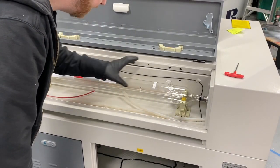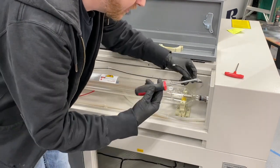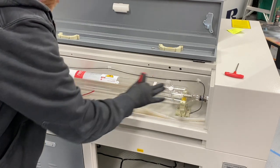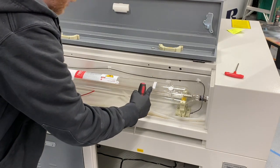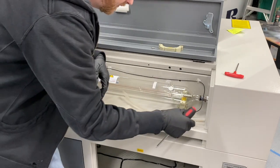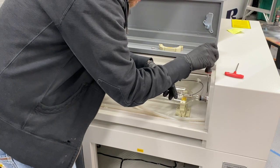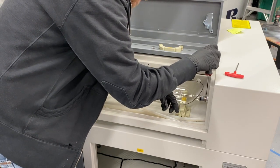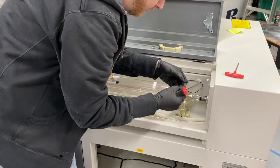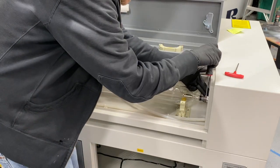Here we are with the tube — I've got it sitting in there but not in its final position yet. We're going to hook up the wiring first before we go too far. The support brackets just need to be somewhere near your bracketing, so it doesn't need to go that far in. The water outlet does need to be up — that's one of the most important things. I've got a Phillips head screwdriver and I'm going to install the ground wire first, so I'll unscrew that a little bit, slide the ground wire in, and tighten it down.